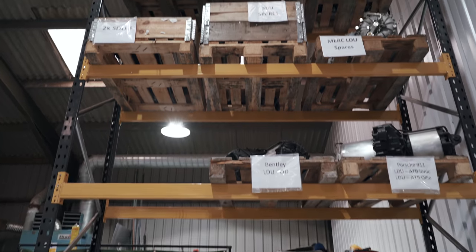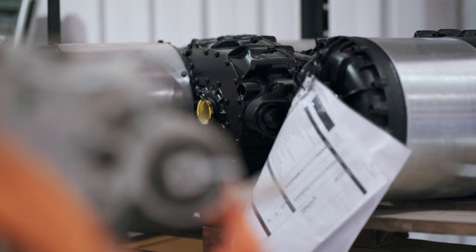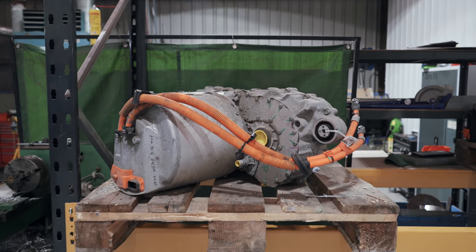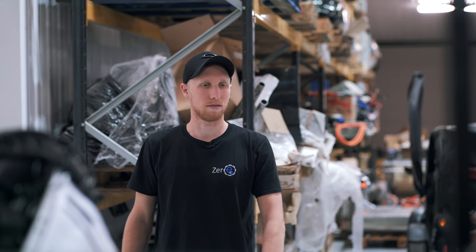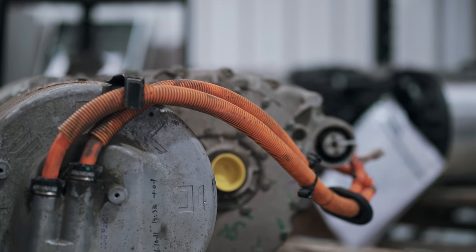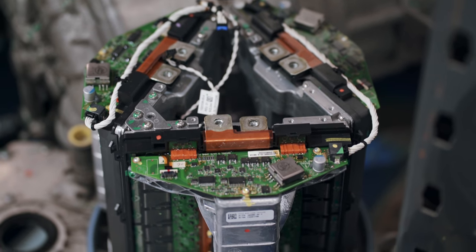The first thing we'll start with is the Tesla selection of drive units. You probably get blasé about seeing all these drive units just sitting on racks — I remember the first time we brought them in and had two or three and it was amazing. Now there's probably at least 20 scattered around in the workshop. We strip them, do the bearings, re-test them all, put them on the dyno, check if it's good — and then they leave us tested and good for another 100,000 miles or so. We'll buy them in eights, tens at a time, a couple of pallet loads from companies. Tesla won't sell a brand new motor, so these are all salvage motors.